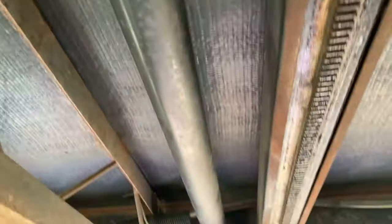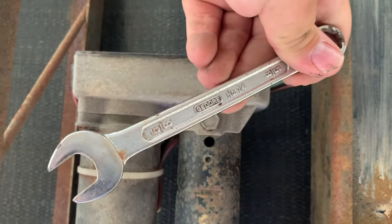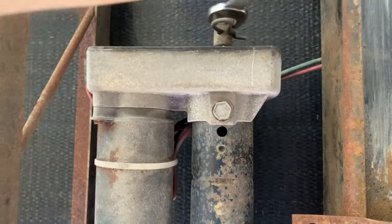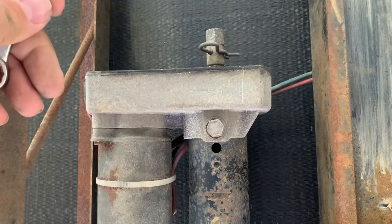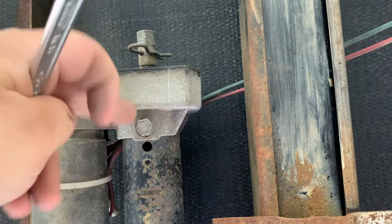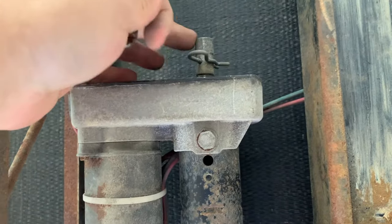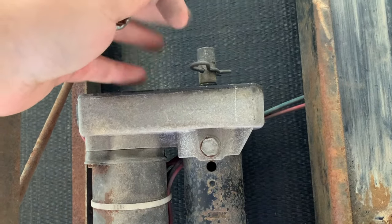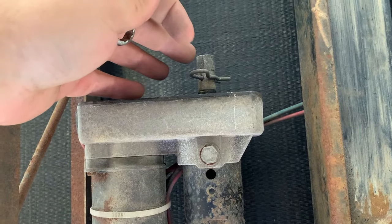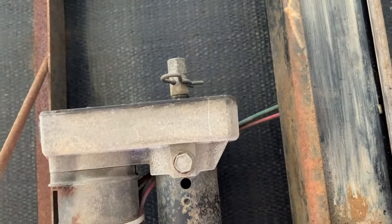You might want to WD-40 that track. Anyway, that's on the Springdale and I'm using a five-eighths wrench — just wiggle it back and forth; if it doesn't go one way just go the other way. That seemed to free it up. As long as your motor's working, if it were the motor I would cut the wires and hook them up to a battery directly underneath to test it. Otherwise it could be the motor, but this was just skipping — something's not lined up. As soon as it bottoms out and goes back out, that's when it gets stuck. The other option is don't bring the slide out all the way in — put a piece of tape on the floor to stop it from coming all the way in so it doesn't get hung up.